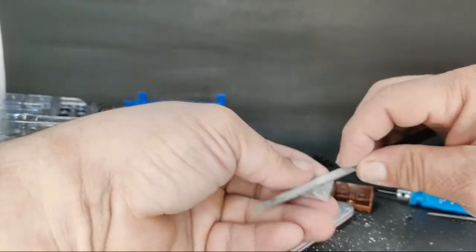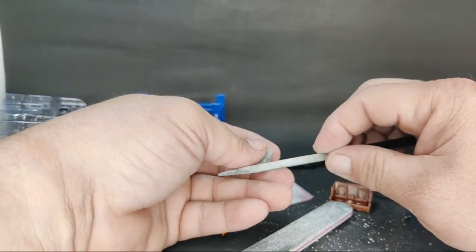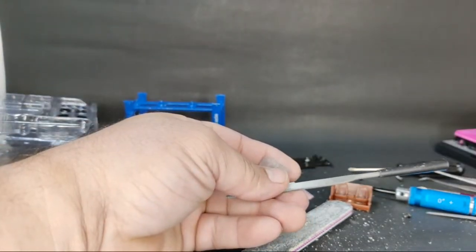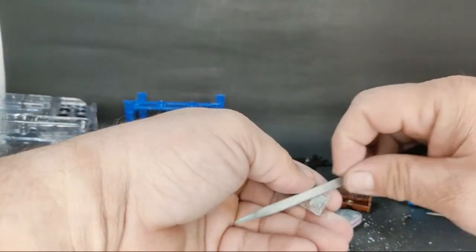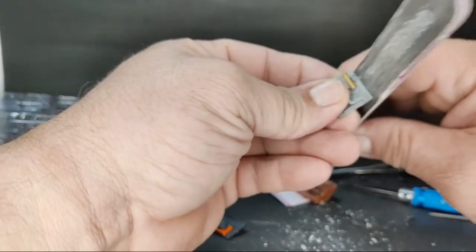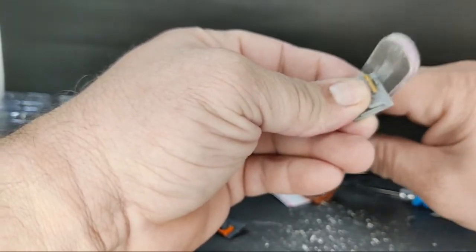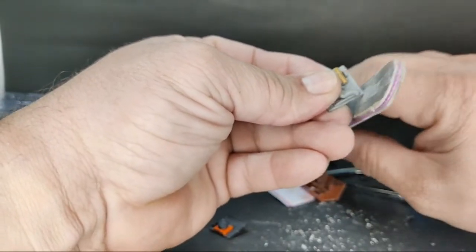All right, let me try this. The housing where the engine sits is not square to 90-degree corners, and that's why you're hearing rubbing every time you push it in. Maybe. But if I sand down the corners, maybe if I do it in an angle, just slightly, and round out the corner just a little bit.